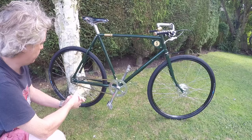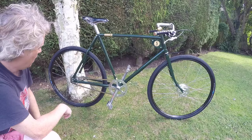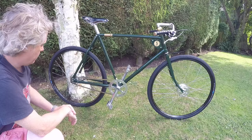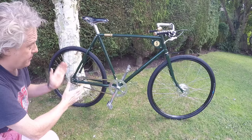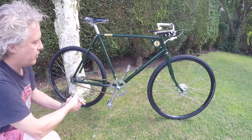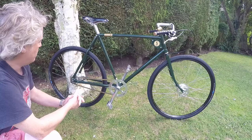On the back, you've got the hub with the internal Sturmey Archer 5-speeder, controlled by a small chain system that goes in and out selecting the correct gear. It's very easy to look after and adjust — you make sure it's in second gear and look for the blue or yellow indicator in the top window to confirm it's lined up. It hasn't had its first service yet, so they'll probably tighten up some of the wires and give it an overall check, but so far it's running really well.